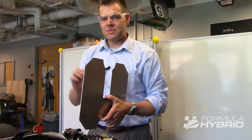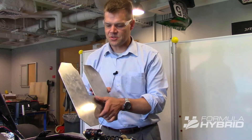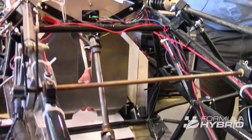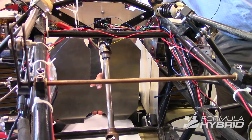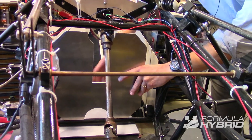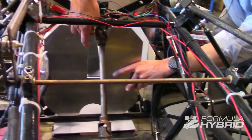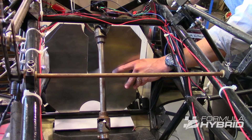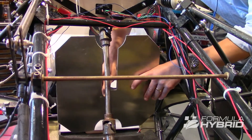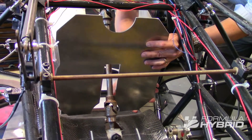For this test, the seat must be in. I'm not going to put it in this vehicle because the seat is very short and won't interfere, and this improves visibility — but please note the seat will be in for this portion of the inspection. We put the template at some point after the front roll hoop and then pass it forward. The template must pass all non-movable wires, padding, and anything else you might find. If padding cannot be removed — for instance it's zip-tied in place — then it must stay where it is. The template will then be passed forward until you reach the steering column, at which point it will be rotated around the steering column and continued on its journey forward.